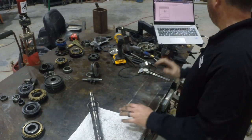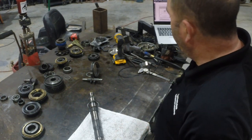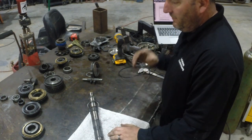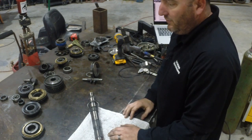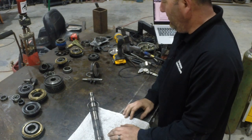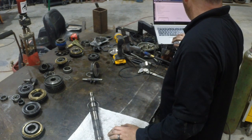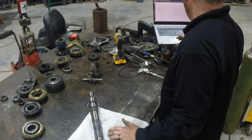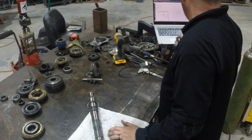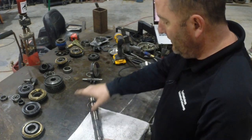According to my instructions, it says to lubricate everything with the recommended lubricant. Normally what I would do if I was actually rebuilding this is have a little pan or cup full of whatever transmission fluid this transmission takes. The spec says the fluid is Mercon ATF, so this one takes ATF. Before you install each piece, go ahead and just dip it in ATF and install it — I typically use little cake pans for that.